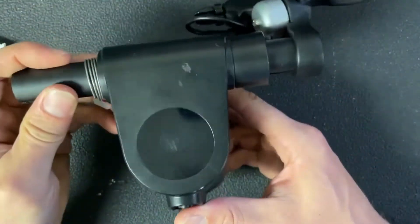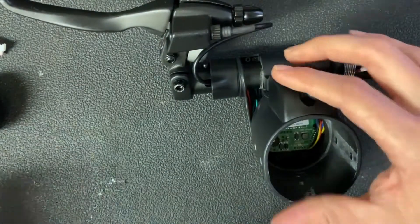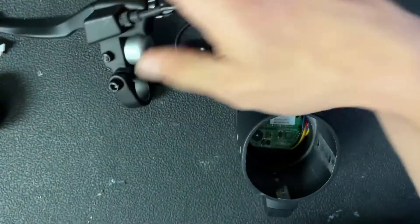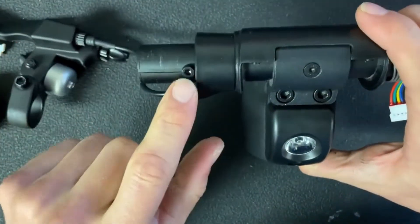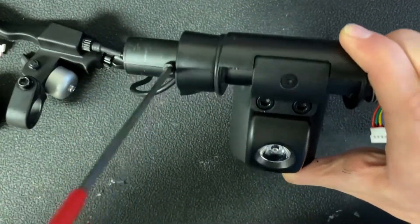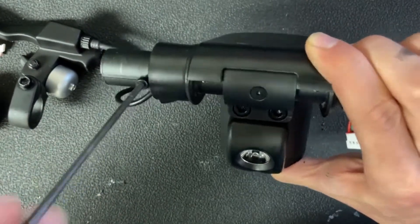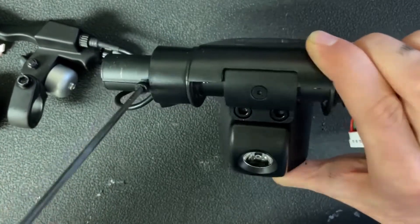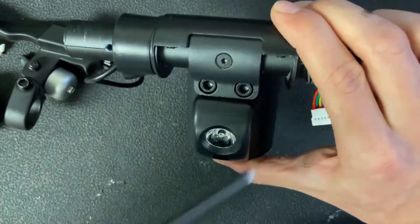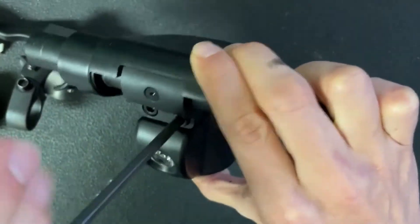Once you have the top unit you're going to be repairing, you'll need to take off the throttle and, on the reverse side, also take off the brake. Use a five-millimeter hex for the throttle — it should slide out fairly easily. You also have three-millimeter hex bolts that will have to come out to slide the plastic covering off. In most cases you could probably leave the headlight on, but for illustration purposes I'm going to remove it as well — it also uses a five-millimeter hex.